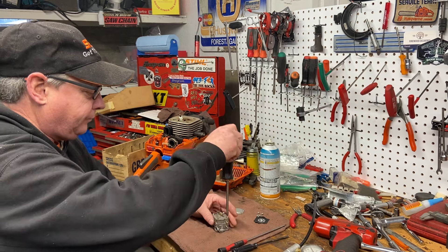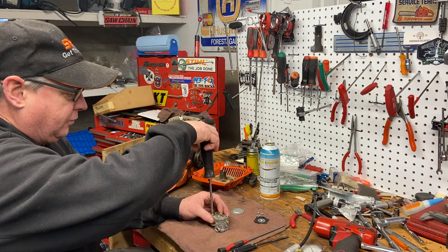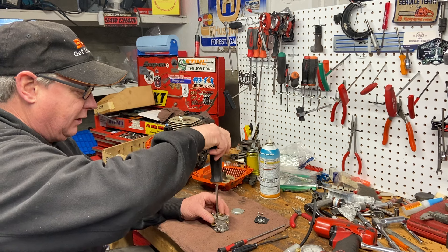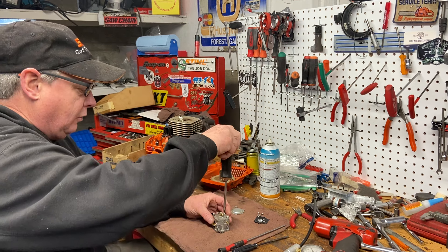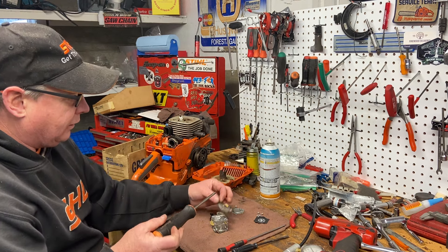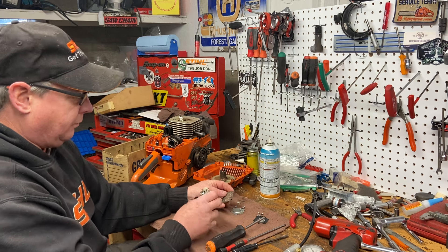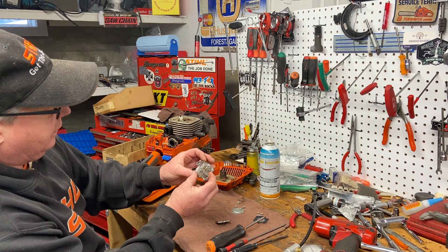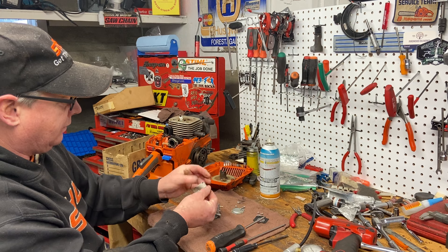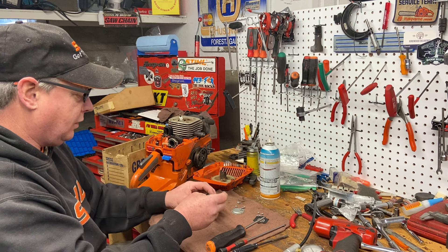The other side is the fuel pump side. These don't have an internal pulse hole system — they have a hose that comes from the bottom of the cylinder up to the fuel pump plate. See that little spigot? That's a different kind of pulse system. You either have one that goes through the intake block like the old 394s, or you've got the hose like this. The screen looks very clean, the diaphragm looks fine — it's the Teflon type, not the rubber type that gets hard. Looks in good shape; flaps look decent, so I'm just going to put it back together.